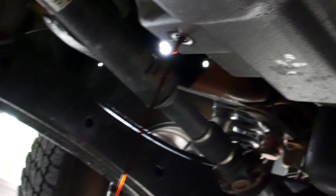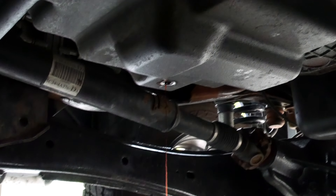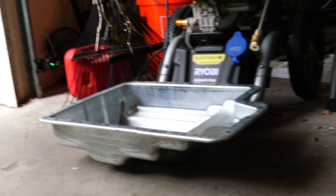If yours is equipped with a drain plug, it's usually just a 13mm. Pull the plug out, drain the fluid, and then we'll take the pan down. So we're draining out the pan and we're almost done here. The fluid looks pretty okay — it's a touch dark, but it does have about 30 to 35,000 miles on it. We'll let that drain out, then pull off all of the bolts and pull the pan down. Then we'll install the new pan.